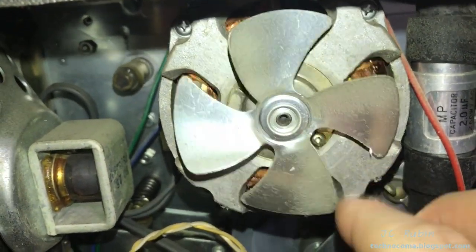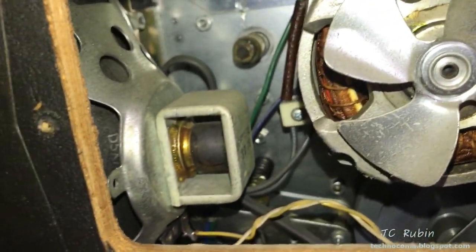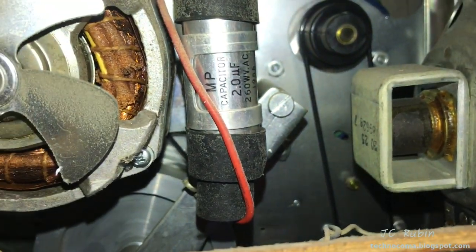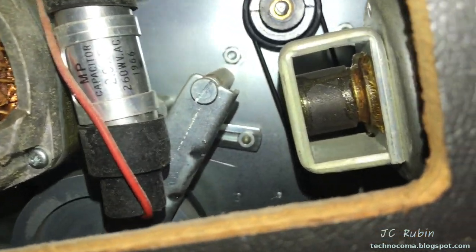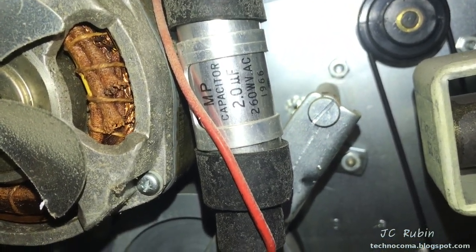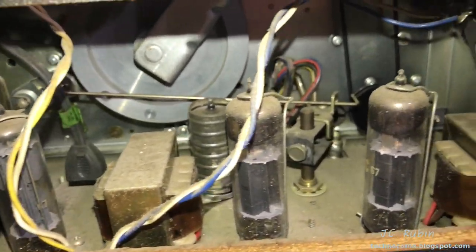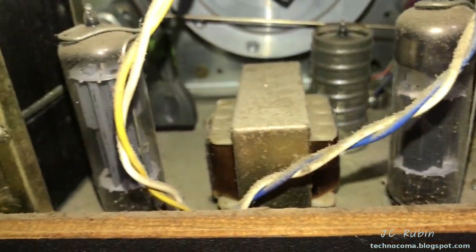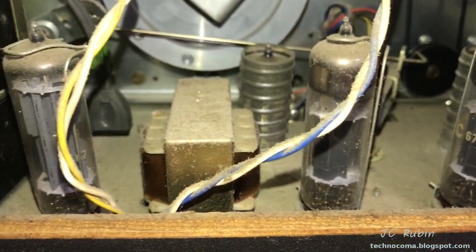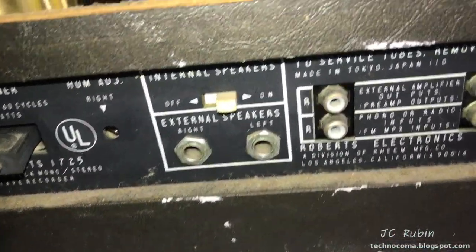There's a fan back here — probably the motor with a fan connected to it. I can see a speaker there, and another one — mostly mechanics. I see a belt back there; belts always concern me, but that's not really what we're after. There's a two-microfarad capacitor over here; I'll have to see the rating for that. So far so good. I count five tubes — everything's on the bottom. Maybe it opens from the bottom too.